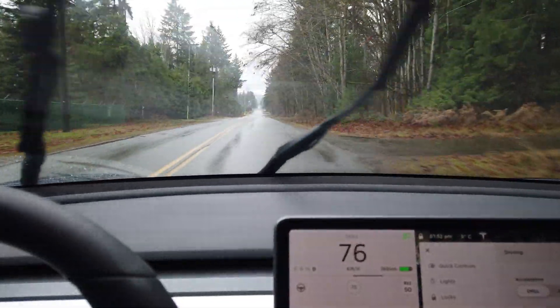Some of you might wonder if this causes premature wear on your brakes, but in reality it doesn't at all. Compared to any normal ICE car, you are barely using your brakes — mostly just to grip the wheels at a dead stop. The rest of the braking is done by regen. So these brakes are going to get a lot more life than the average car. Doing this once a week is not going to hurt you at all.